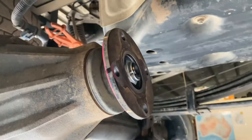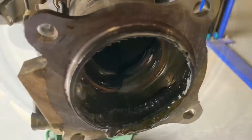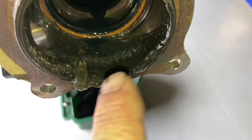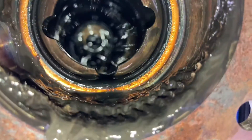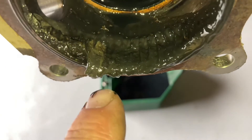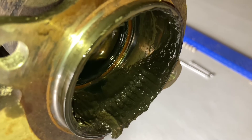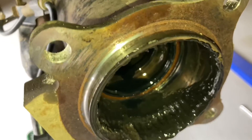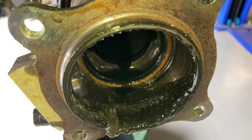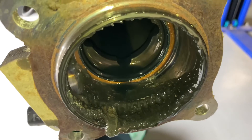And look at that — like magic, the propeller shaft has disappeared. Now all we need to do is get the axles out and boom, the diff center's gone. Let's have a look in here. This is messy — that ain't meant to look like that. Has there been some water in there? Has it sucked some water in at some point? If you're at high K's and you want to do some diff work, you should probably do your pinion bearings and seal and just do the whole job. Our Sunshine Workshop partner loves doing the whole job properly, but this is the cut-corners job. Poor man pays twice — you do this and then later you've got to do more work anyway.